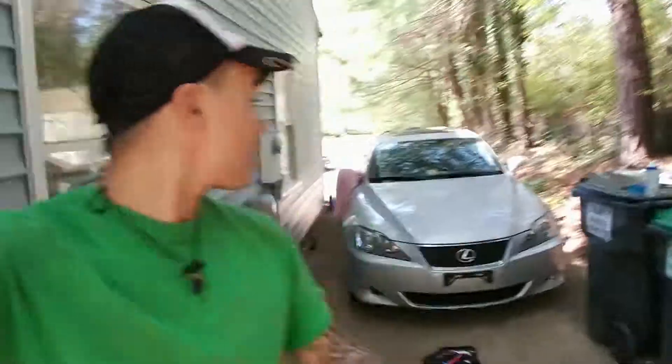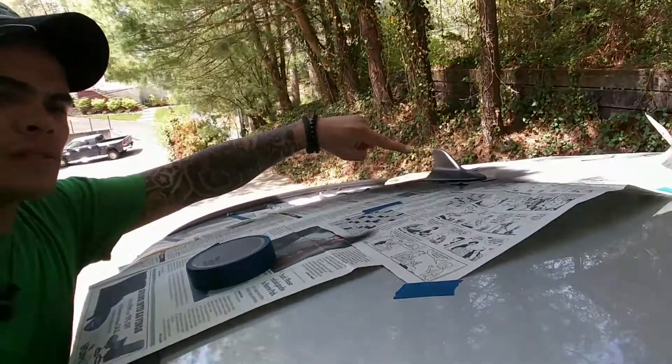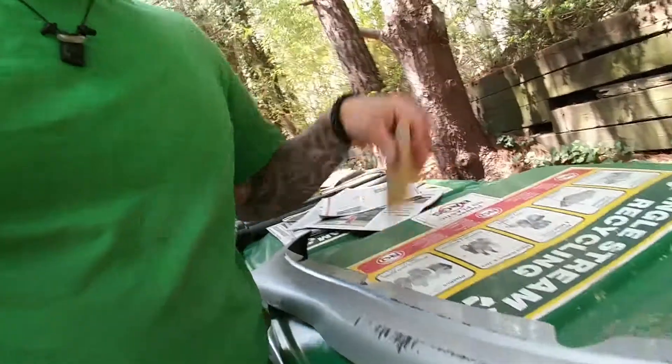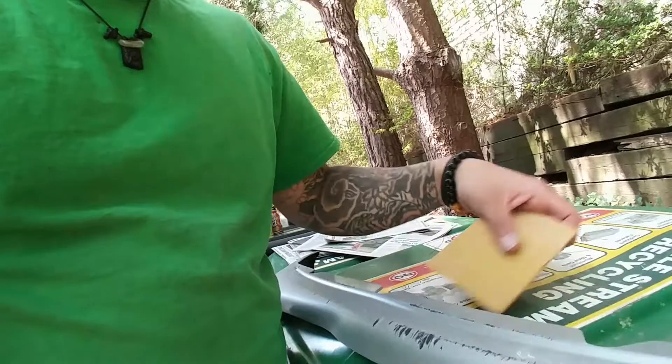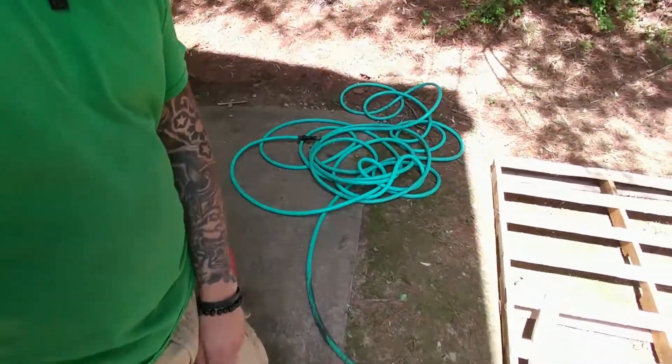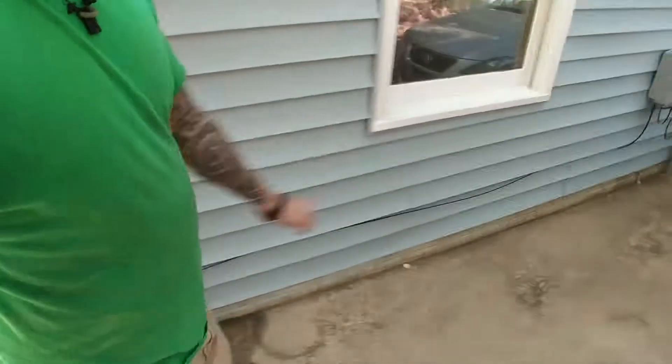The top of my shark fin is black now. Moving on to the lip — you can see the scratches are pretty deep, so I'm taking some sandpaper and slowly roughing the edges, smoothing them out as best I can. Then washing and cleaning them to make sure there's no grease from my fingers, from the road, or from engine drip, so the paint can stick properly.